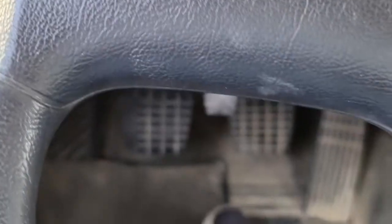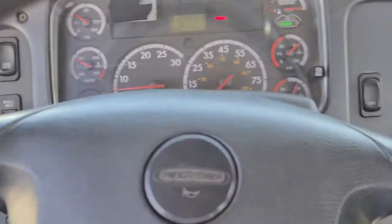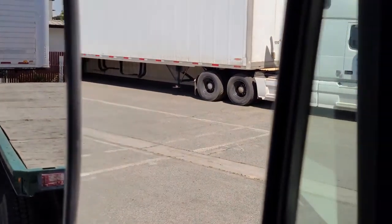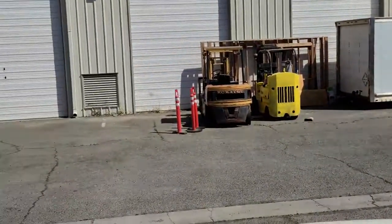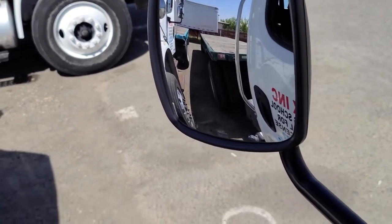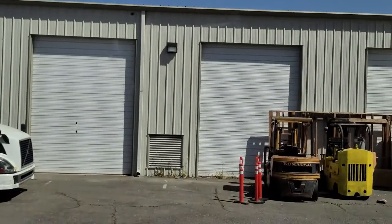This completes all my air brake tests. Now that the vehicle is running, I like to perform my in-cab inspection. First thing: my seat belt — I'm gonna make sure it's not ripped or torn, it's securely latched and unlatched, securely mounted to the floor and vehicle, no missing hardware. I'm gonna inspect all the mirrors — make sure there's no cracks or breaks, they're securely mounted, no missing hardware, and all my mirrors are adjusted for me to drive. My mirrors don't have any illegal stickers obstructing my view when I'm driving. My window — I'm gonna make sure it rolls up and down, it's not cracked or broken, securely mounted, no missing hardware. My windshield is not cracked or broken, is accessible, and is securely mounted by the rubber seal. My rubber seal is not excessively worn or torn and will not leak.